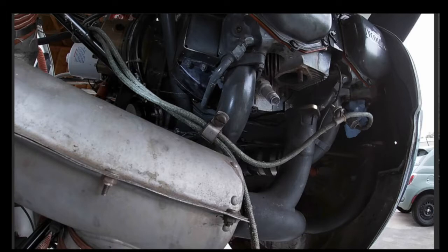One of the things that I did want to mention is that upon further inspection, once we got these things off, this cylinder over here had a crack in it in the same exact place. So I don't know what it is about these cylinders. A couple weeks ago I was watching a video, Tag Along with Chet. I don't know if you watch him, but he had the same problem, and it was almost on the same day that I watched that video that we found out that this was a problem. And I think his Piper is the same year as mine. I think it's a '67. So I don't know if it's because of wear and tear or the blowtorch that's going through this, just wearing away that metal. But it was cracked in exactly the same spot in exactly the same amount.